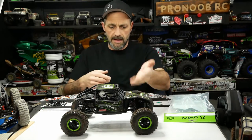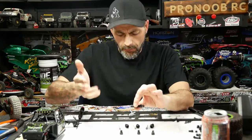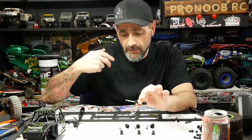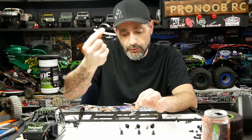and then we'll jump back in and talk about the limiting and taking out the spacers on the bottom. Okay, Jesse's got the shocks broken out for us here, guys. So, a quick explanation of how we lower these. We've done it before. We just want to show any of our new viewers the theory behind internally restricting the limit of the shock using some nitro fuel tubing.